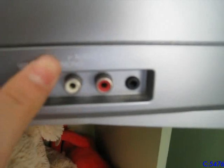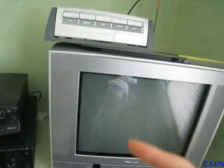On the front here, you get the power button, infrared receiver for the remote, and power indicator. You've got channel up and down. It's also got a front composite input with a headphone output — though unless you're going to use an extension, it's probably not a great idea. Some people sit really close to the TV. There are stereo speakers; it's only that little bit that's actually the speaker, everything else is just the side. At least it's stereo and mono compatible — you just plug in the mono channel and it'll bring the audio between both speakers.